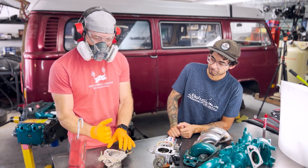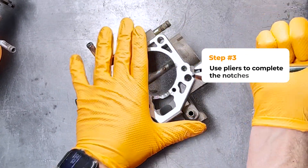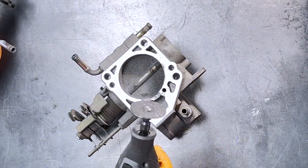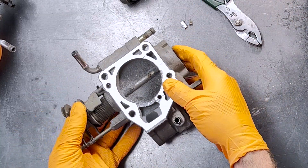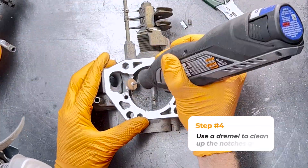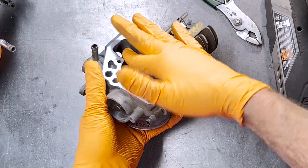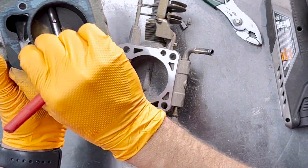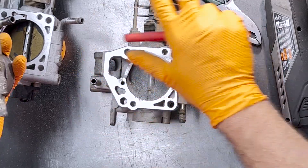We just did three notches — I'm going to grab some pliers and try to pop those off. This one should break off right here, and we'll clean that up. This one I'm going to notch again — one more notch out of that. You can see we're looking a bit rough right here, but that's all right, we're going to clean it up. As you can see, we've got a nice clean bite out of there. Same throttle body: before has that notch, after it does not. We clean these thoroughly.